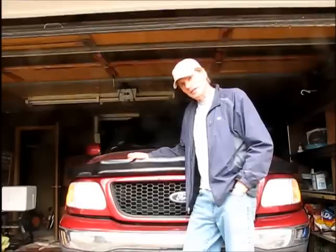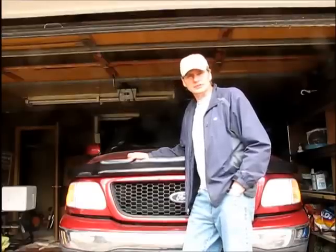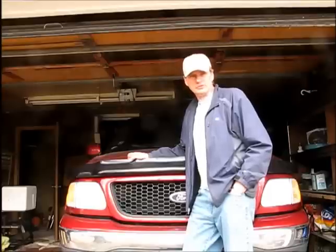Hi, I'm David, and this is a 5.4 liter 2000 Ford F150, and the starter has some problems. A couple of times this winter it failed to turn over at all for me, and with a partner, I tapped on the solenoid on the starter and got it to go. So in this video, with the starter already out, I'm going to test it, rebuild the starter and the solenoid, and then install a new solenoid.